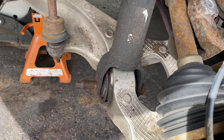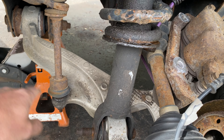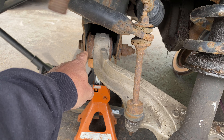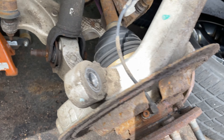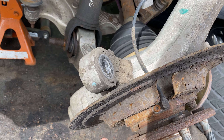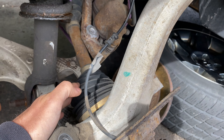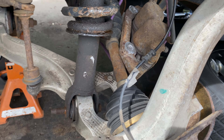Hopefully. Other than that, I may have to remove this entire lower control arm, which would mean removing that big giant bolt and bushing — I could have the same problem there. I would also have to remove this assembly here; there's a ball joint down there. That might lift out of the way without having to remove the driveshaft, but it's a huge pain. So I'm hoping that this method will work — let me grab some tools and start cutting things off.